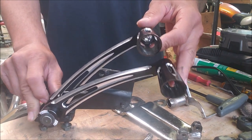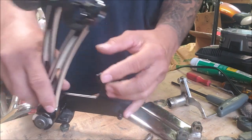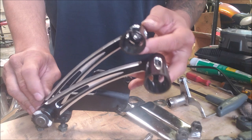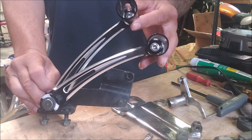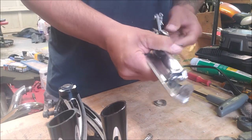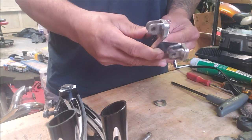I also have to be able to put my front and rear brake light switches on here. I'll probably cut this bracket off — maybe shorten it or put other tabs to mount a master cylinder farther back, because having the lowers there means the master cylinder sticks out too far and hits my lower fairings. I'll keep this heel-toe setup in my back pocket as a fallback, because it has both a tab for a return spring and a connection point for the plunger from a master cylinder.